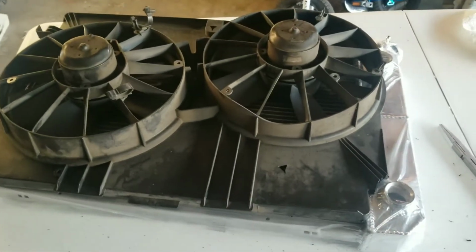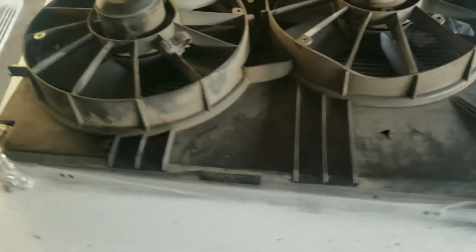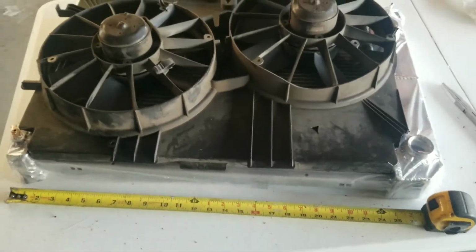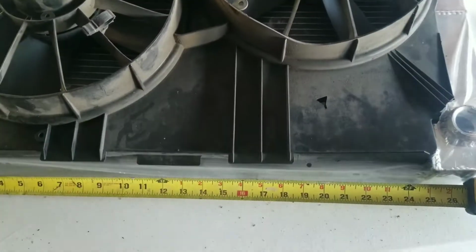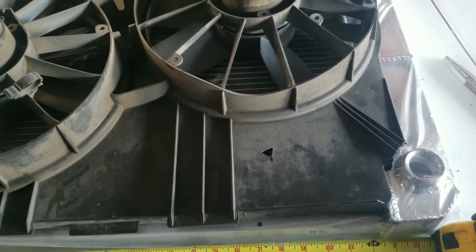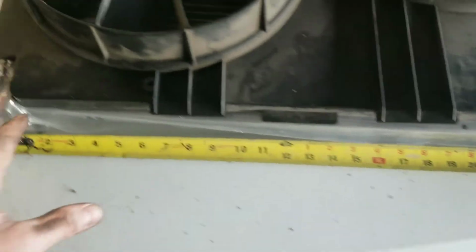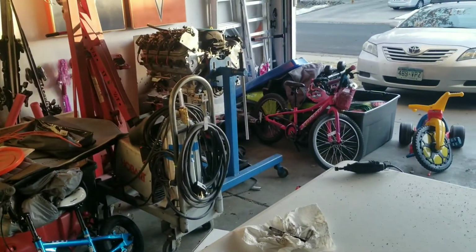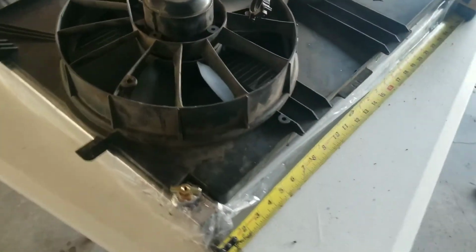All right, so completion. I've got everything notched and fitted. Minimum damage to the radiator. So I dropped down a tape measure here to see this. So this Becool radiator, I opted for the wider one. They had 2 available on Holly. This one's just about 27 inches wide, but the reason I bought it wider is because, again, this fan shroud was out of a 2001 Chevy Corvette, which is where I acquired the LS motor right over there. And it seemed to work pretty good.